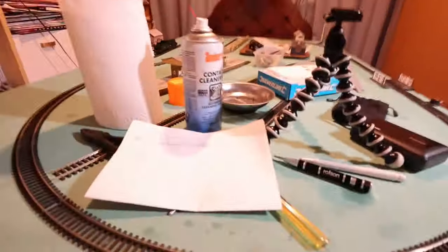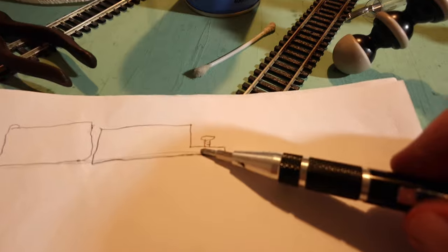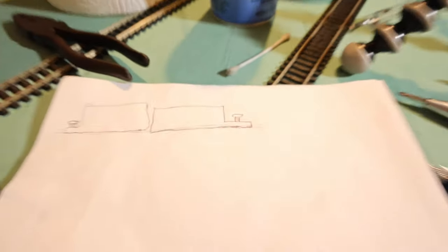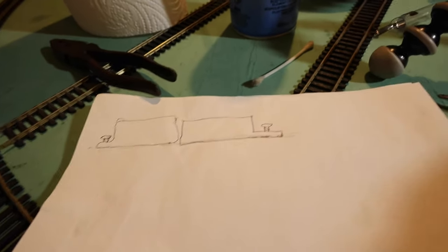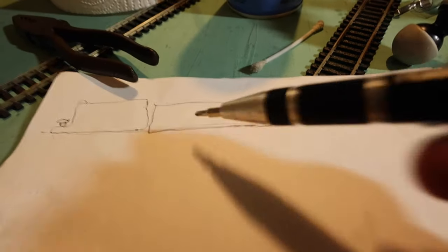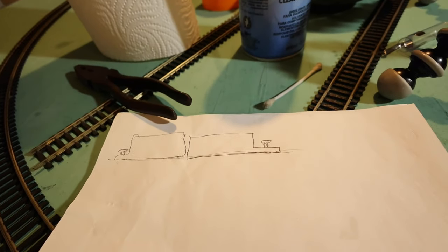So if you imagine what I've done, I don't want to bore you by going over it too much, but let's just stop that around there. If you imagine you bend that bit down there, okay, so I'm bending that down, I bent that down with a pair of pliers. If you do that screw too tight, it's going to sort of lift it back up again. And I reckon that's what caused it at some point to become all bindy. So that motor cover there is pushing down too hard on the worm drive, and it just needs to be adjusted. Okay.